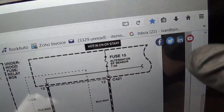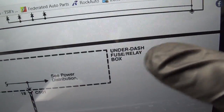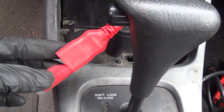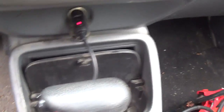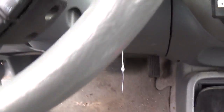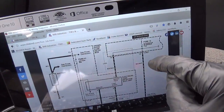The fact that we're not charging and our battery light's not coming on - that's the fuse I want to check first. It's fuse 15 in the under-dash fuse and relay box. Let's locate that and get our test light out. We've got our test light connected through a power probe adapter to the cigarette lighter, which is usually a reliable ground and power source.